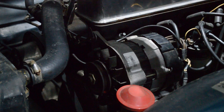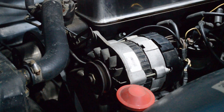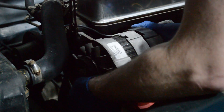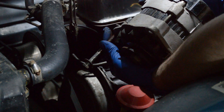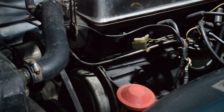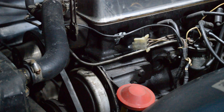I'm loosening the bolt on the water pump housing — that's what lets this adjust so I can get it out of the way. There's the alternator out. I was taking it out carefully because you've got these spacer pieces that will fall off the end of the bolt. There's a gap in there that goes on the mount that attaches to the block. Now let's compare our alternators.